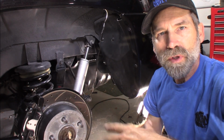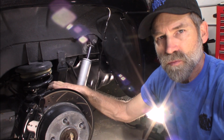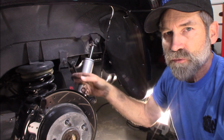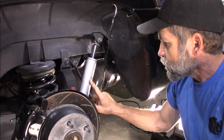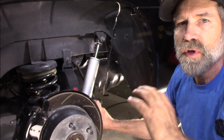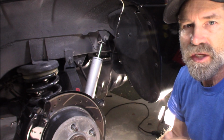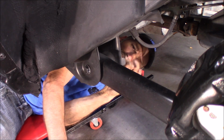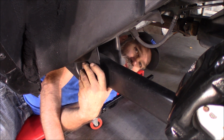Also want to let you know what kind of equipment I got in here right now. I got Eibach lowered springs in here. I got Grant limit straps. These are 14 inch, running the Gabriel shocks on here. And I also have a 1-inch diameter Addco sway bar for the rear. That really reduces the body roll on this vehicle for sure. All right, I'm going to start by removing the bolts that hold on the control arms. This is all 21 millimeter hardware.